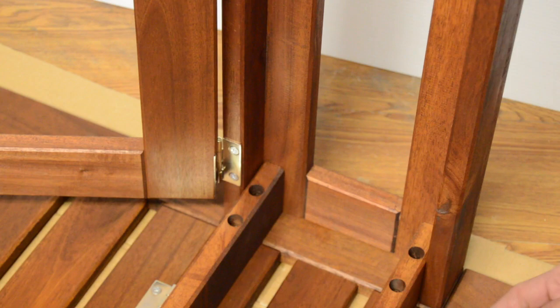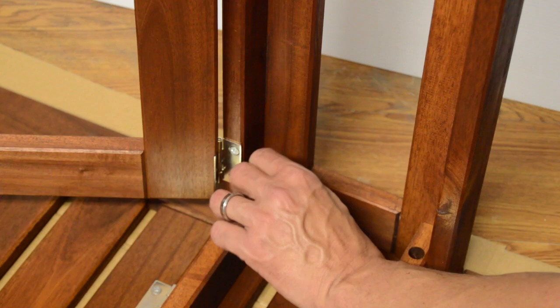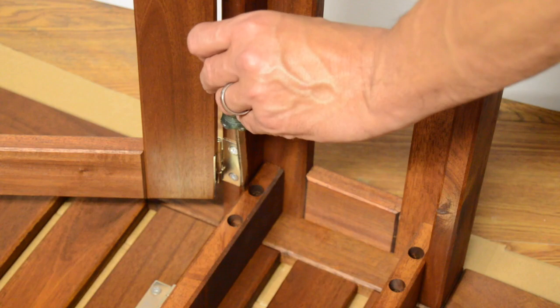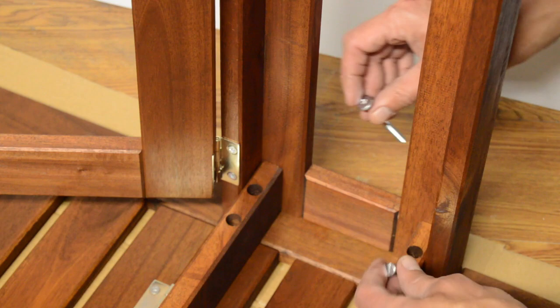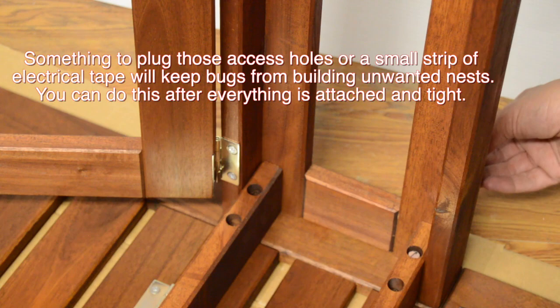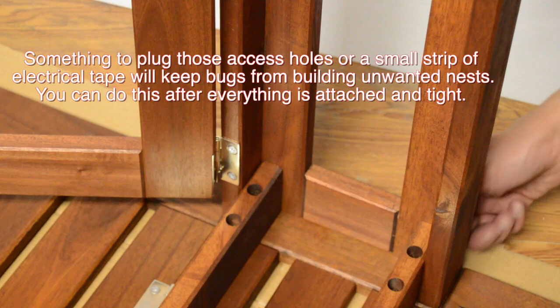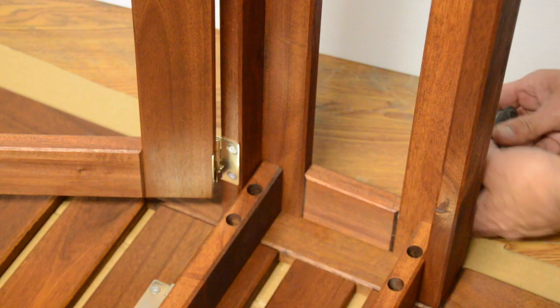The other one wouldn't really do that, so I'll show you a little trick for that. Basically, you've got this nut and a long bolt, and you'll want to drop that into that little hole with the flathead screwdriver — the one with the little line should be facing out where you can see it. With your flathead screwdriver, just take and line that line parallel to where the bolt is, so the hole in the nut is parallel with that line and lines up with the screw. These little screws you should be able to just thread in by hand. Another little tip: you might put some tape or something over those little exposed plug holes — if it's going to be outside, you don't want spiders laying eggs in there.